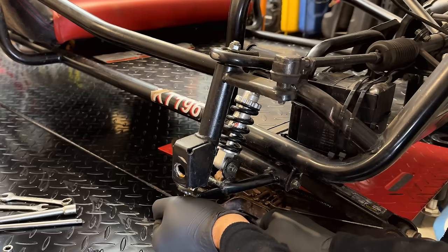Yeah, we're at 1.179. So it's actually a little bit less, about a thousandth less than the new crank, and that's kind of to be expected. I'll look up what the acceptable wear is on a crankshaft of this type, but I don't think a thousandth is going to be an issue, especially since it wasn't knocking in the old engine. So let me pause it, take a quick look what it's supposed to be, and make a decision.